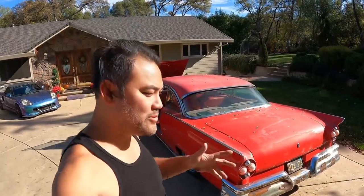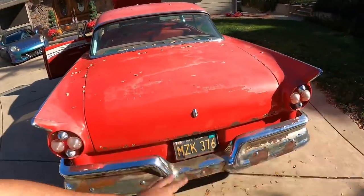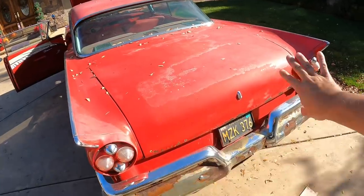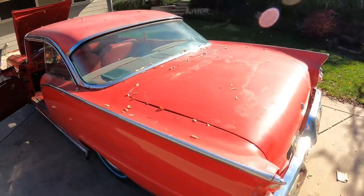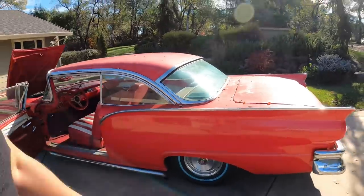The body shop that's gonna be doing the full kit on this thing later on when we go wide body, they'll be doing all the other stuff that I messed up on anyway. So I'm not too worried about doing it incorrectly. What I do know is what I've done on my 90s cars, and it's been fine so far. So that's basically get rid of the rust, wire wheel it down, sand it smooth, and then Bondo over any divots that we need to Bondo over, spray some primer on it, sand the primer, and we're good to go. So that's really all you need to do on this particular car.